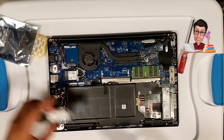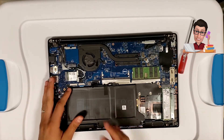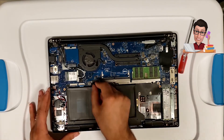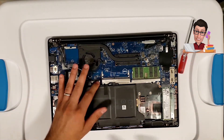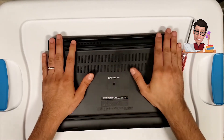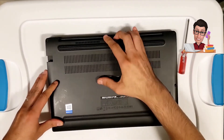Those are the main components — very simple. The battery is held down by one screw, the M.2 is very easy to remove, and memory is always easy to upgrade or replace. Once you're done with everything, reconnect the battery by pushing it in until you hear it click, making sure it's snug on both ends. Then place the cover back on and push it down lightly until it clicks — don't force it.